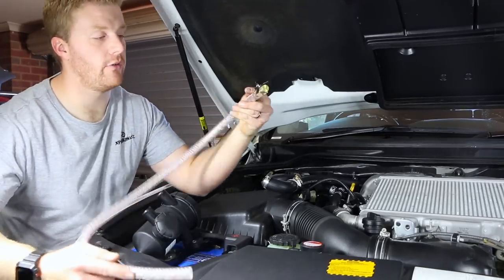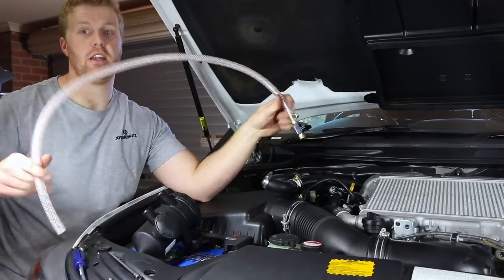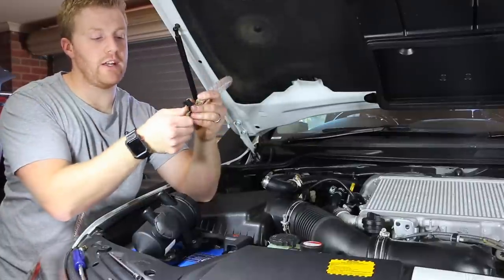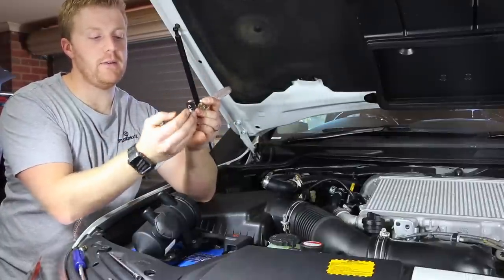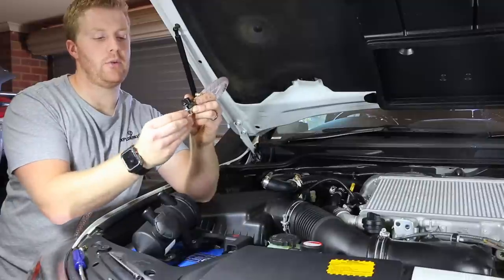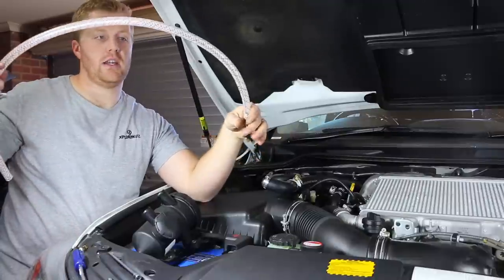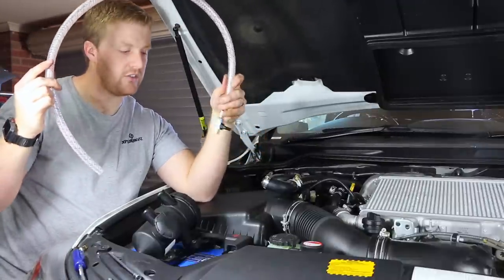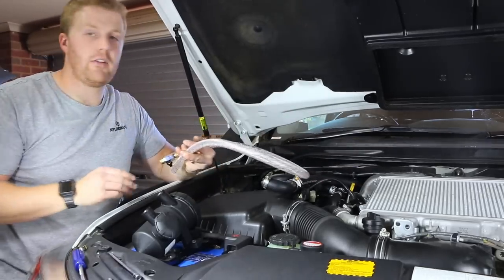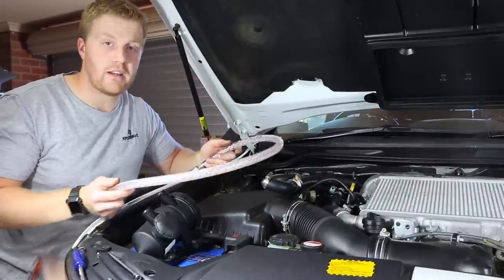One thing I really do like about the ProVent 200 is the drain hose. It can be mounted anywhere underneath the car, it's clear so you can see the oil level, and it's super easy to drain — just undo the small bolt on the bottom of the tap, flick the tap across, and when finished close the tap and replace the bolt. We're going to leave it at full length, install it on the base of the ProVent, put the ProVent down into the area making sure the drain hose goes down into the wheel arch, and then plumb the lines and fit the ProVent to the bracket.